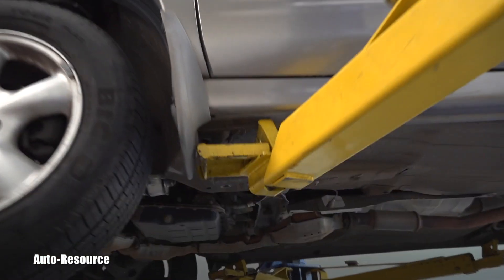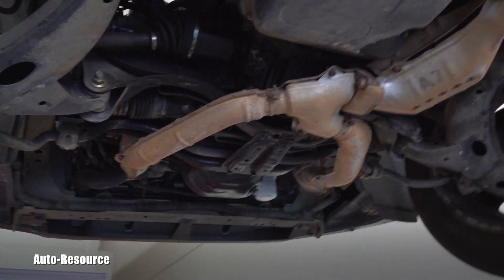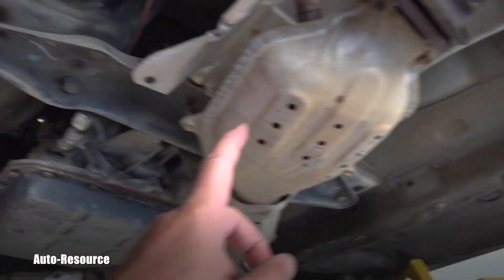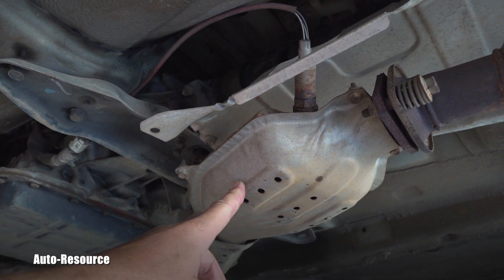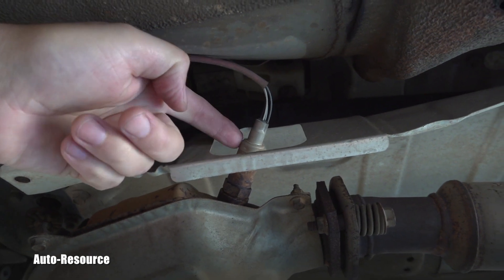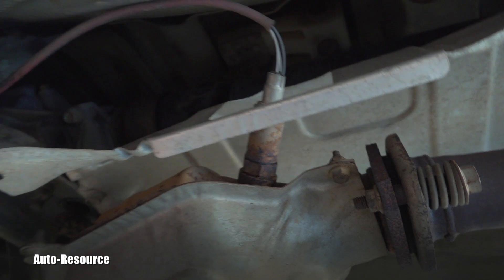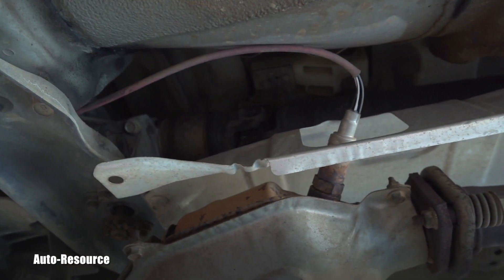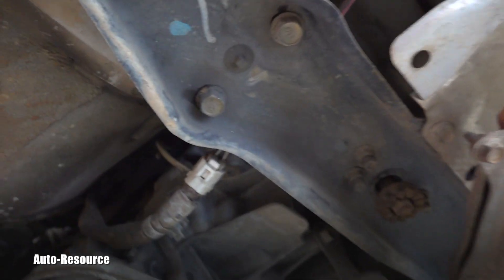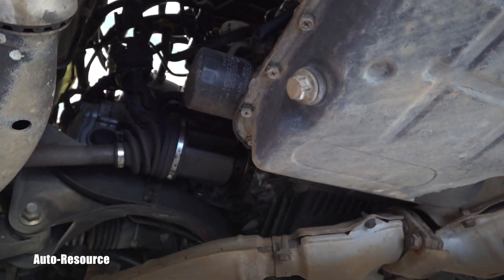The Forester is up in the air, so let's take a look. You can see the exhaust coming out of the heads and continuing all the way to the back of the vehicle. The catalytic converter is easily visible, and right after it is an oxygen sensor. This one looks perfect — nothing wrong with it. But wait, we said B1 S1, which means bank 1 sensor 1. This is bank 1 sensor 2, so this is not our problem. The other one must be in front of the catalytic converter.